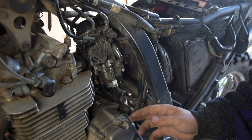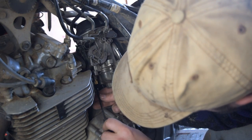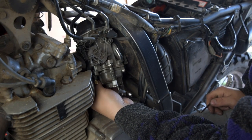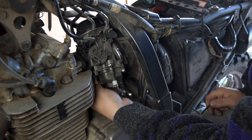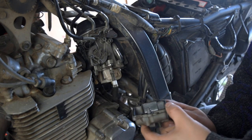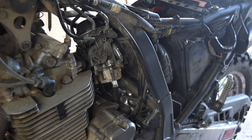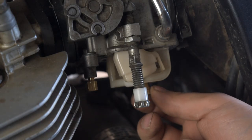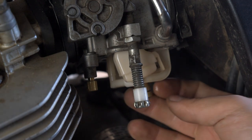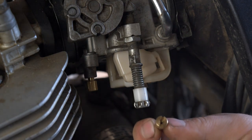Now you want to rotate the carb up so the bottom comes out on the other side. You can imagine if we had those Phillips screws trying to get this off - it would be near impossible. But with these hex head screws, super simple. There we go - and if you remember from when we had it apart on the bench, the main jet is just wide open right there. Because of the location I can't give you a good angle - that mix screw is in the way - but we have the main jet just hanging right here right off the bottom of the carburetor. It just unscrews - it's a chisel tip screw, and there it is, the stock 140.